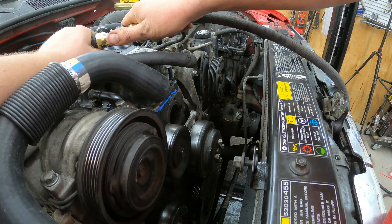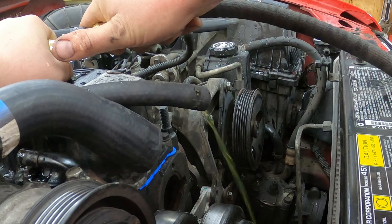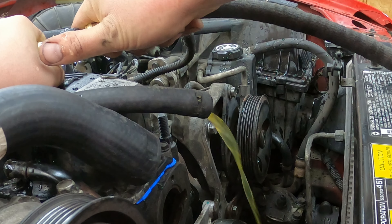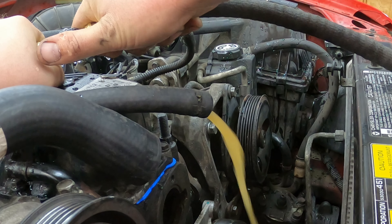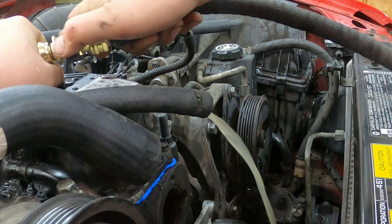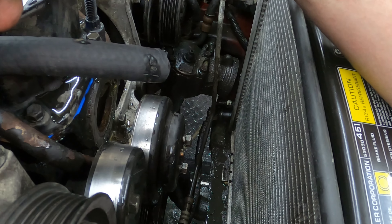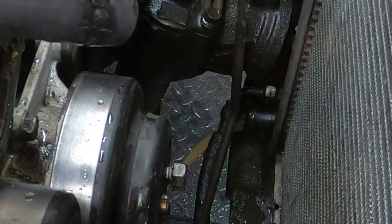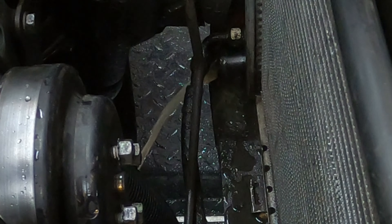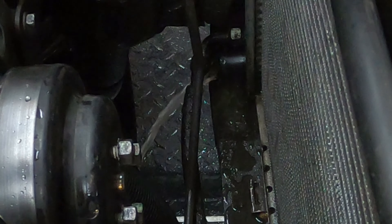Now because we have oil in the coolant, I'm going to flush the system. This is one of the heater core hoses — I'm going to push some water through. Look how brown and nasty that is. I did this several times through every opening in the coolant system I could, and I'd do it until it ran clear, then switch and back flush it over and over. Here's the radiator — look how nasty it's coming out. I did this like five times on every opening of each hose, and every time more brownness came out — so be thorough and get her clean.